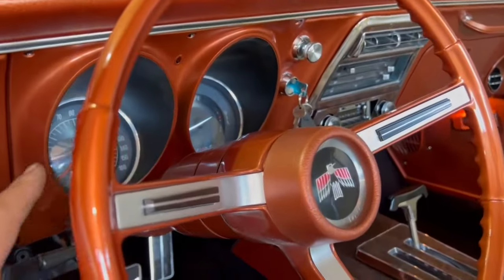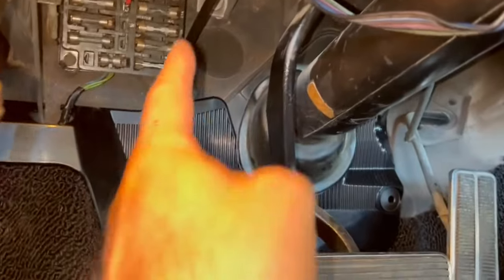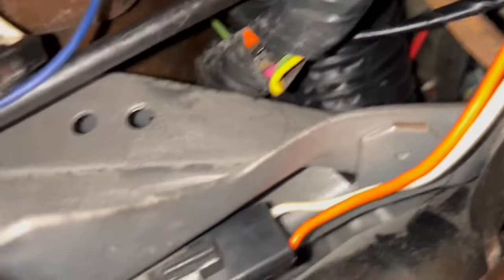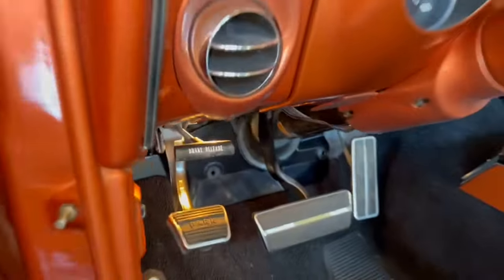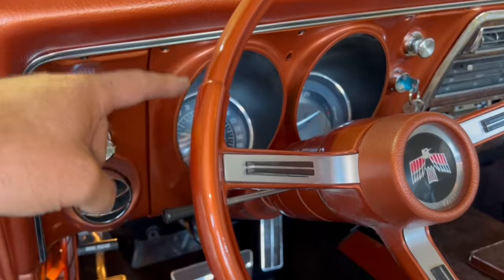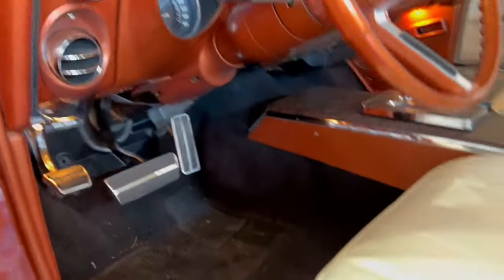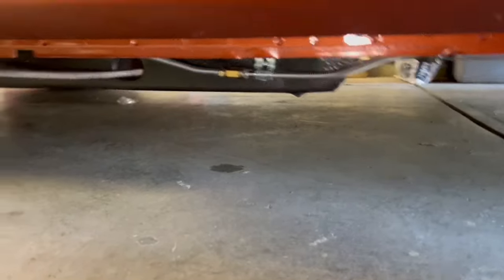So where do we start? It only started making more noise as we're moving the speedometer heads, so first I'm going to inspect the speedometer cable itself. It pokes through the firewall right here by our fuse panel and should make a nice, clean, straight shot up into the backside of the cluster. There's wiring up in here, it's kind of hard to tell, but that actually looks nice and straight. So I don't think I've kinked or damaged the cable during removal or installation. First thing we're going to do is go underneath the car, jack it up, and undo the speedometer cable from the rear of the tail shaft of the transmission, then just give the speedometer cable a little twist.